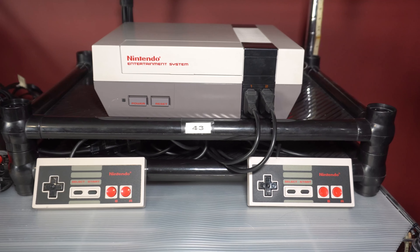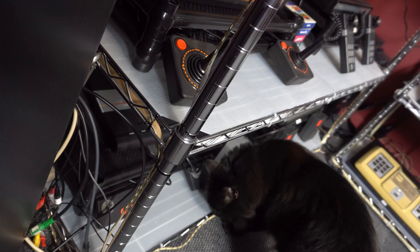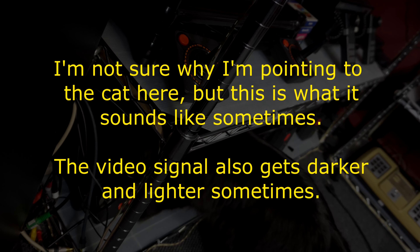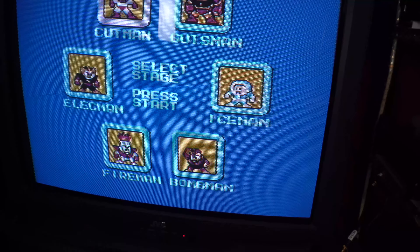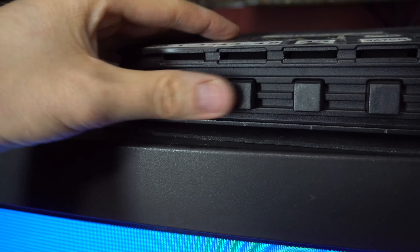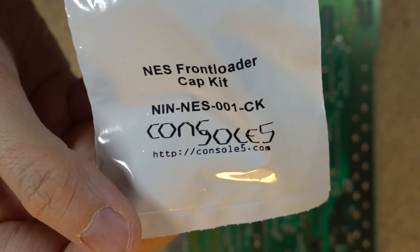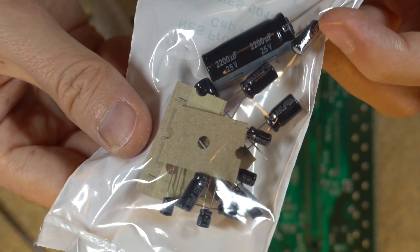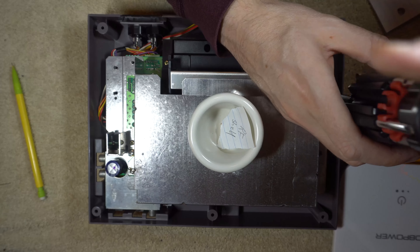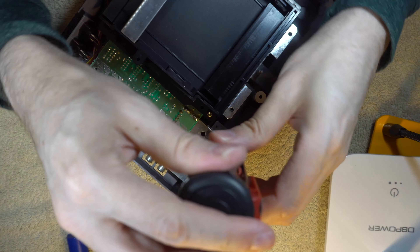Time for something a little bit more complicated. This is an NES I've had for years and the sound has some fuzziness to it, and the sound also goes up and down in volume as I'm playing games. I think it's because there's bad capacitors in there. The switch box on top of the TV — if I mess around with it, I can make the sound become fuzzy and go out as well. So this may not be a capacitor issue, I'm not sure. But I do feel I need to take that option off the table and just replace the capacitors inside the NES. I get my capacitors from a website called Console 5 — I'm not associated with them, I just bought them with my own money. They basically sell repair items, a lot of it being capacitor replacement kits.